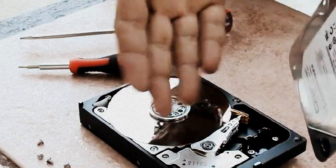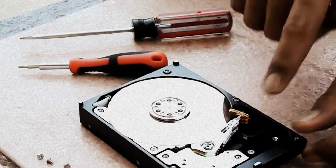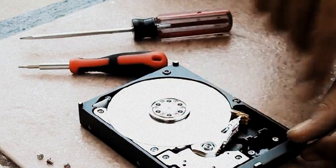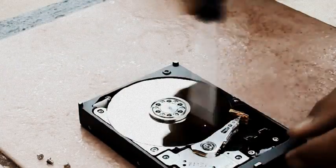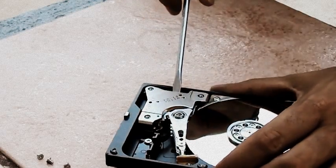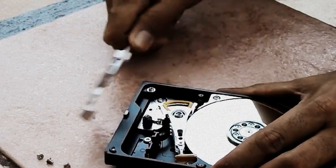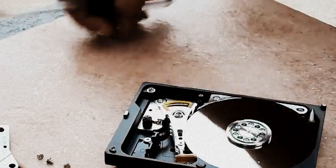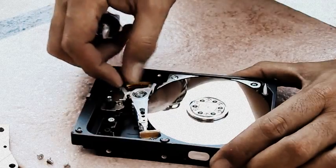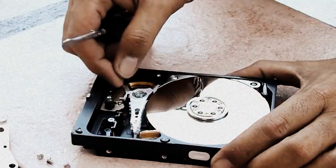You need to be very careful. First, we need to pull the read arm back from the hard drive and take this piece off. Get your screwdriver. Right here on top you have a magnet — it's really hard. You need to be really careful because you can damage something. Just turn it off. Now you can pull this thing — as you can see it moves. Now take this off — it goes back. Now, as you can see, we have the hard drive and the readers are not touching each other, so now you can take out the disc.